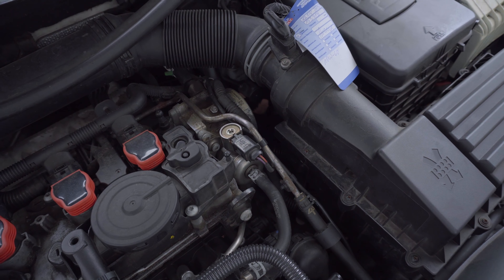What you need to do is straightforward: install upgraded spark plugs and coils. This is important because when you tune an engine you have higher combustion temperatures, and a race spark plug helps with combustion so you don't run into excessive temperatures or get a melted piston. The catch can system is also important on these engines because the OEM PCV system is very weak and not large enough, especially if you push hard on the track — you'll see smoke coming from the exhaust on the stock PCV. I always recommend installing a catch can system.